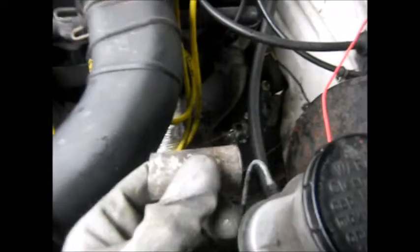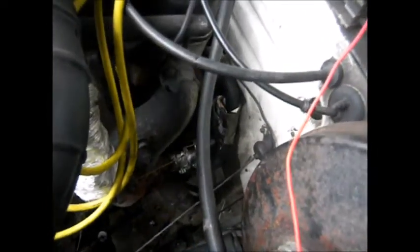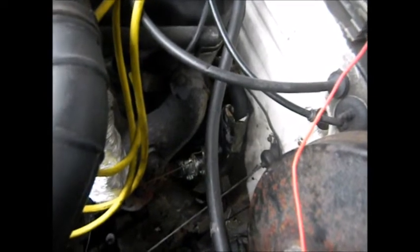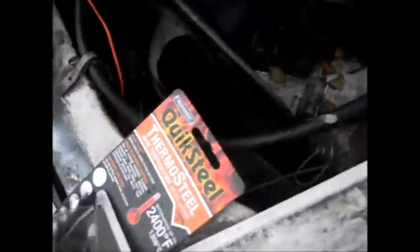What I've got now is this thermal seal. Instead of putting a sleeve over the two ends, I put a pipe in between — so it's actually inside of both the EGR tube and the manifold nut area. Then I wrapped it with aluminum and then I wrapped it with fiberglass. We'll soon find out — I've heard some pretty good reviews about this stuff.